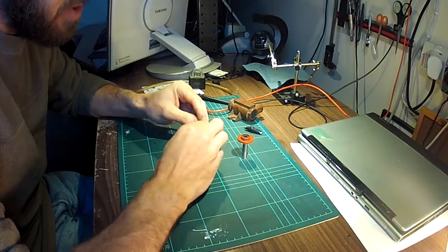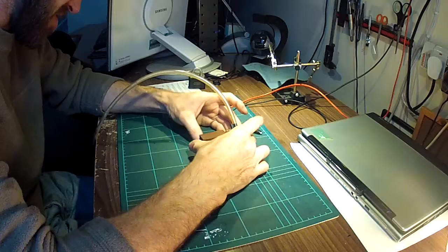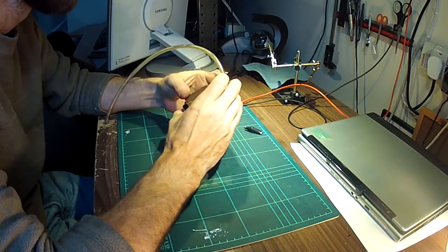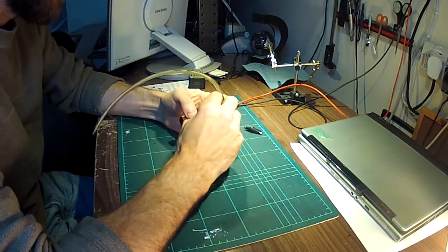The problem was this valve being blocked open, which meant vacuum wouldn't build up — and that seems fine now. There was a blockage but this is a really simple system. What we could do to test it further is hook it up to the electrics. What I'm going to do is put this all back together and crimp this down so I don't have to hold it together, and then I can play with the electrics whilst blowing through all the ports.